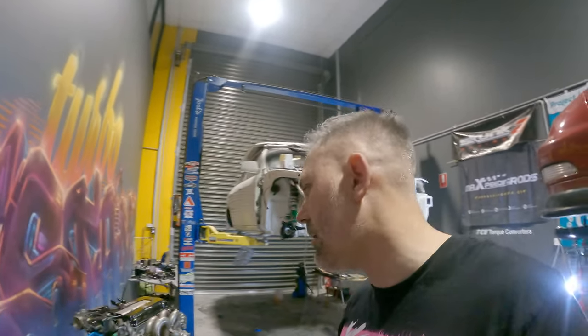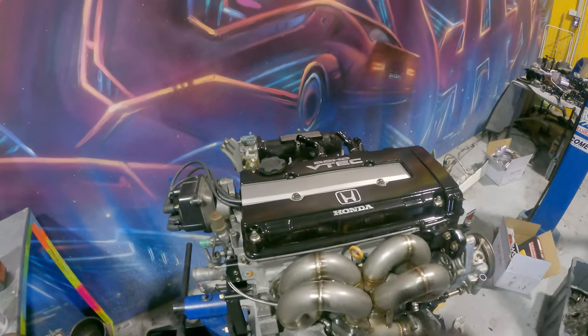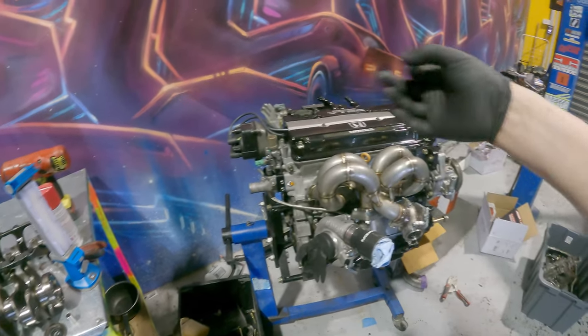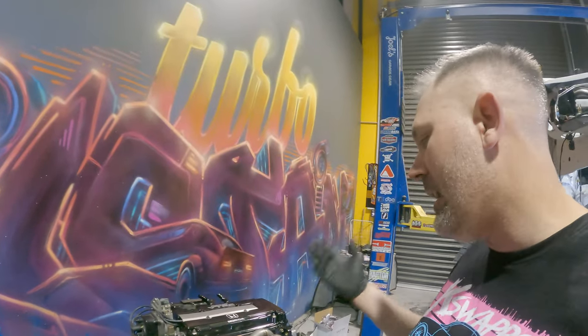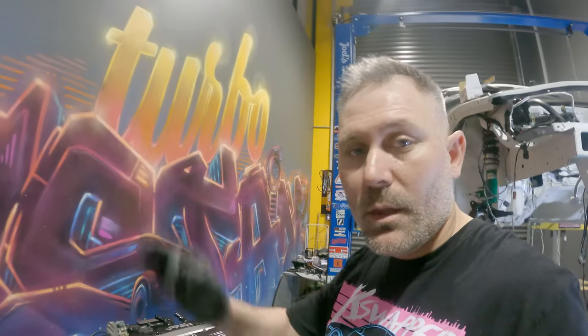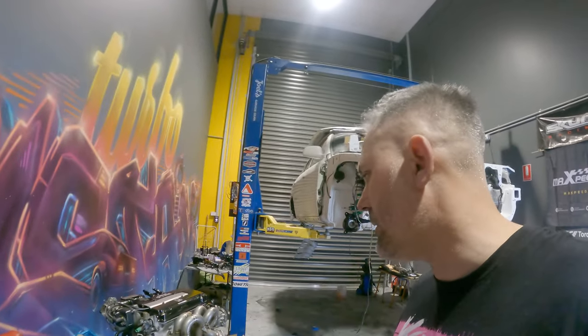It's been a long haul - we started this six months ago. She's fully sealed up and the valve lash is done as best as I can manage. I've made it drag on every single one - turned the engine over, checked it, turned it over again, made adjustments. I'm pretty happy they're all even: intake is 0.17 mm and exhaust is 0.19 mm with a bit of drag with the feeler gauge through there. I've done them on the tight side of the tolerances.